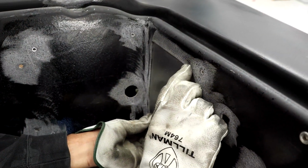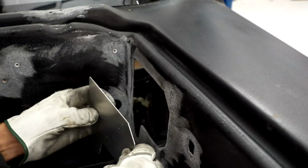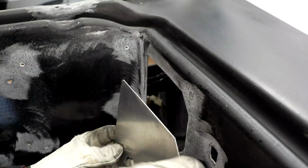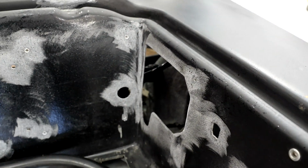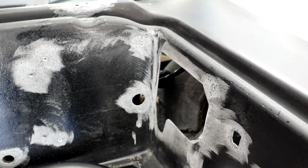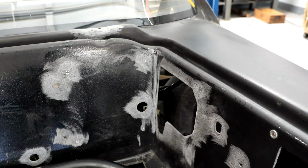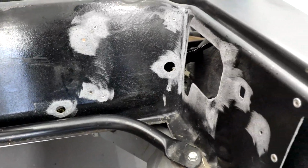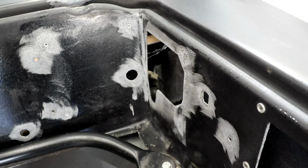Martin's got the aluminum piece cut out for this. The reason that he's adding this piece here, not only is to create strength back in this fiberglass piece, but also to make sure that he's got a nice flat surface so that it looks really clean when he paints. When you are trying to fix fiberglass, you kind of want to grind into this and create a little bit of a concave shape. That way the fiberglass can kind of fall into it, and then the Bondo on top of it, the bodywork, can fill in that gap so that when it's sanded flat, it's not too thin and you lose a lot of that strength. And now allowing him to do that with the aluminum that doesn't bend or deflect will mean that he's going to have a really nice flat surface so that when we paint over it, it's super clean and nice and looks factory OEM.